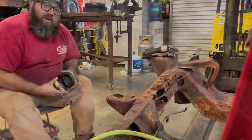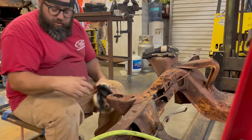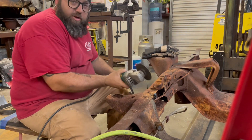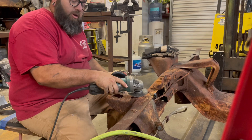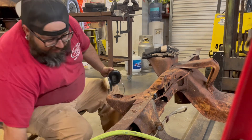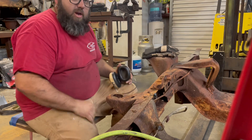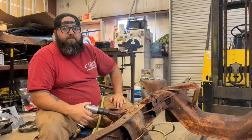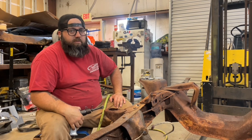A couple of ways to tackle this — everybody has their preferred method. You can take your cutoff wheel and cut an X in the rivet head and use your air chisel to knock the rivet head off, or you can grind the rivet head off. A lot of times if you have a decent enough air hammer or air chisel you can just chisel the head of that rivet right off and then knock it out with the air hammer. Let's give it a shot with an air chisel. As you can see the air chisel didn't work for it — let's get the grinder out.